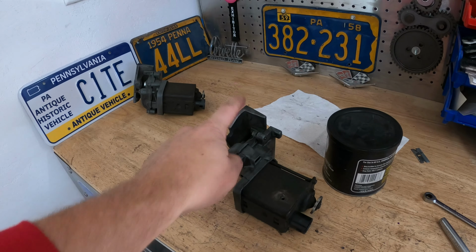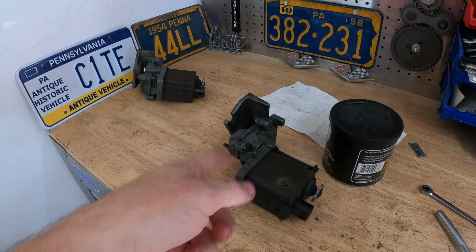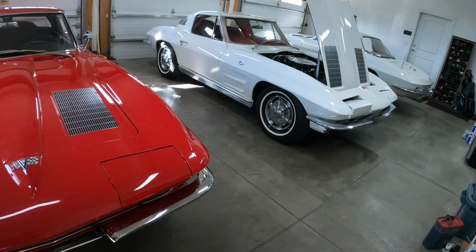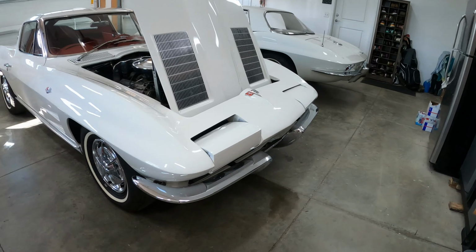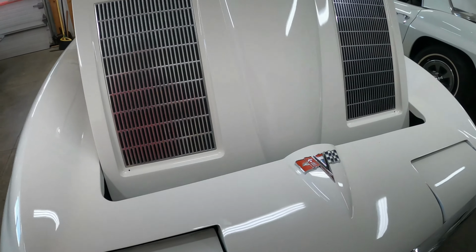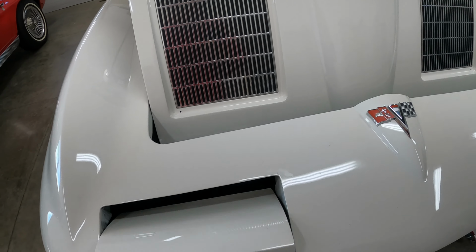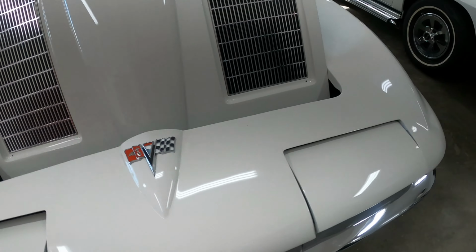So both motor gearboxes are refreshed with new grease and new main gears. So now I'm going to put these guys back in the car. I have the car in the warm garage now. Another thing you can do while you have the motors out is just roll these over by hand, just to make sure that they roll nice and free.